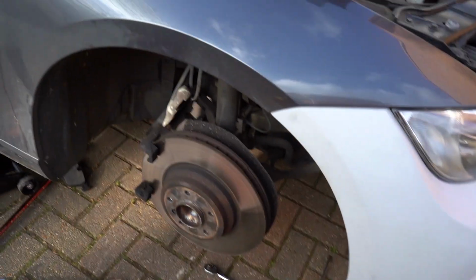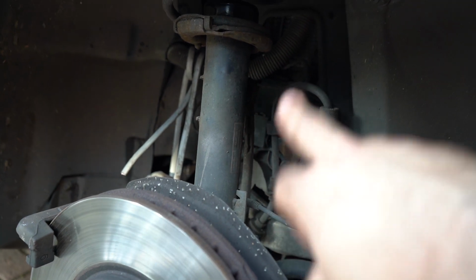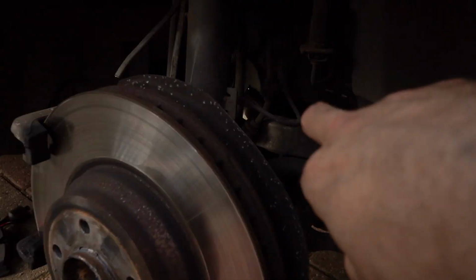Stay like that. Yeah. Alright, so we're on number two. This one's a lot faster, less sensors. One sensor to unplug, take the caliper, hang it over there, and then the three bolts undone. We've just got to get this control arm out here. Bless you. My bad. We're in another video. And then we're going to drop it out and try to do the same method, yeah? Something like that. Oh, mine's got a hammer.